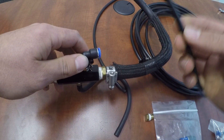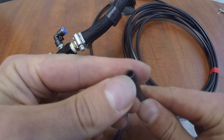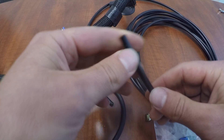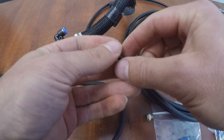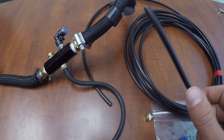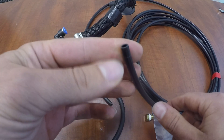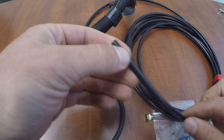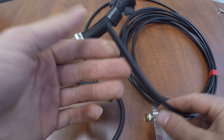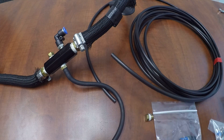It's way nicer than fighting with hose and barbs and cutting the hose to get it off. Just shove it in, push it to the end, and it's locked — you can hang it by it, it's not going anywhere. I've used these for methanol injection kits and vacuum lines. The line is polyurethane, so for any high-heat areas just get a heat sleeve and throw it over top. My last setup was making over 700 horsepower — ran it right past the exhaust manifold to the wastegates with a heat sleeve and never had any melting issues.